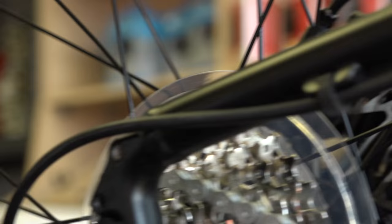All fat bikes should have full casing from handlebar to parts like the derailleurs. This helps prevent cables from getting water inside. That's a benefit for having hydraulic brakes too, because with a cable system it's actually easier for water and dirt to enter.